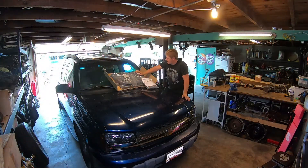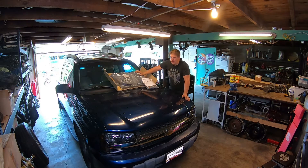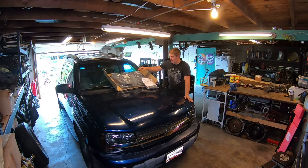What I have here is an electric fan conversion kit. To my knowledge, nothing in the GMT 360 platform came with electric fans — they all had mechanical fans, no matter which engine, options, or package. I want to make a little more room in front of the engine, and I really like the customizability and tunability of electric fans, especially a dual electric fan setup like I'm putting in. It lets me control when the fans come on and off, and whether they're running high speed or low speed.